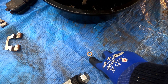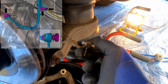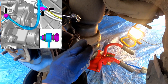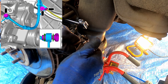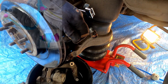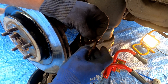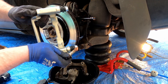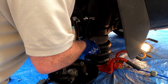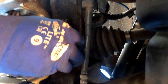So we've got a new crush washer for the banjo. Let's see if that fits on there. A new crush washer at that end - two new crush washers. What's the torque on that? I think it's 140 if I remember correctly. But the new carrier on - just need to put these 15mm bolts in position.